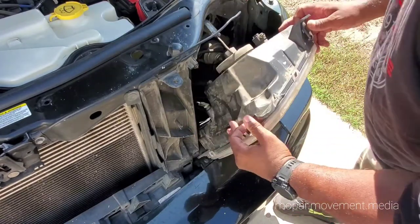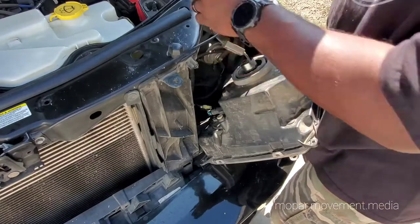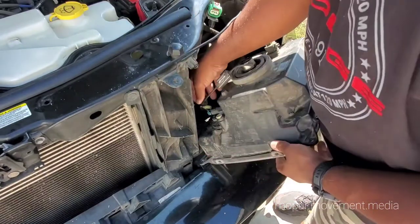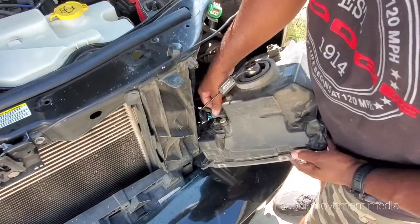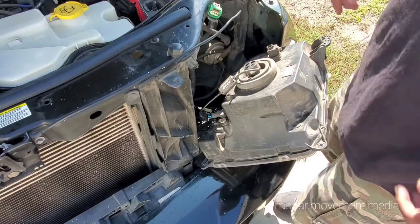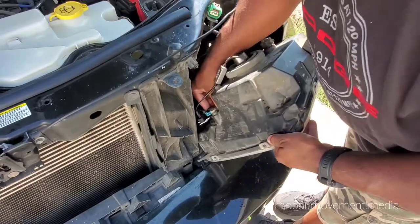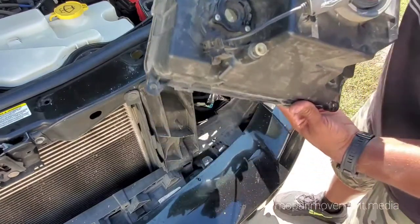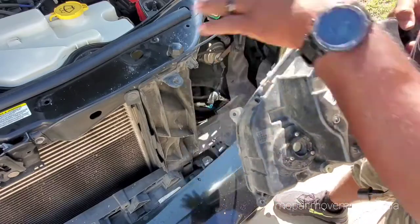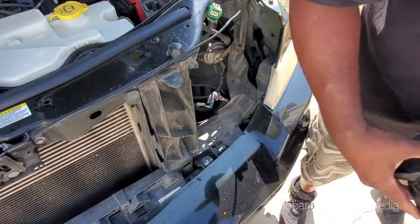This is just super cool. We've already done a sort of an LED light upgrade but it plugged right into the factory harness. Slide the little red part down to disconnect that. Down here you want to pull out the fog light bulb — this is the only way to get to this fog light bulb. You've got to pull the whole headlight out: grill, headlight, everything. You will never be able to reach it and get it in there right. I had a hard time getting an LED bulb in here because it was so tight, so I had to loosen these, put the bulb in, set it, and then tighten them back down. Anyway, this headlight's off.